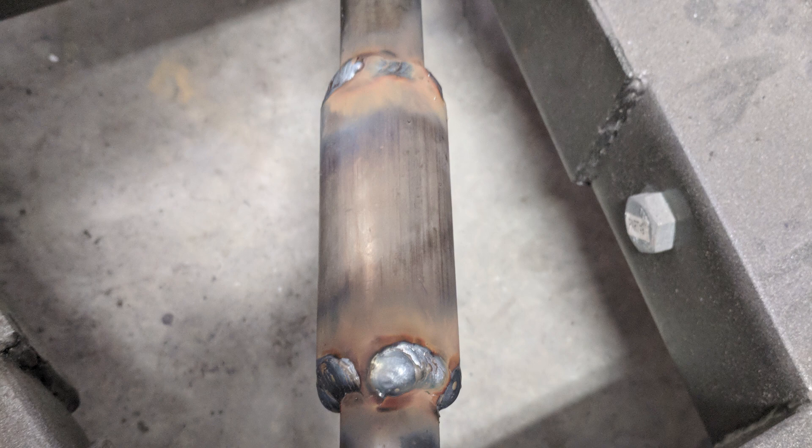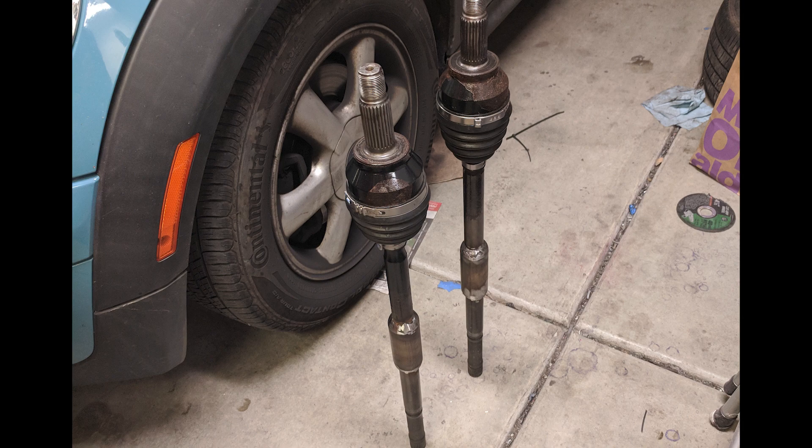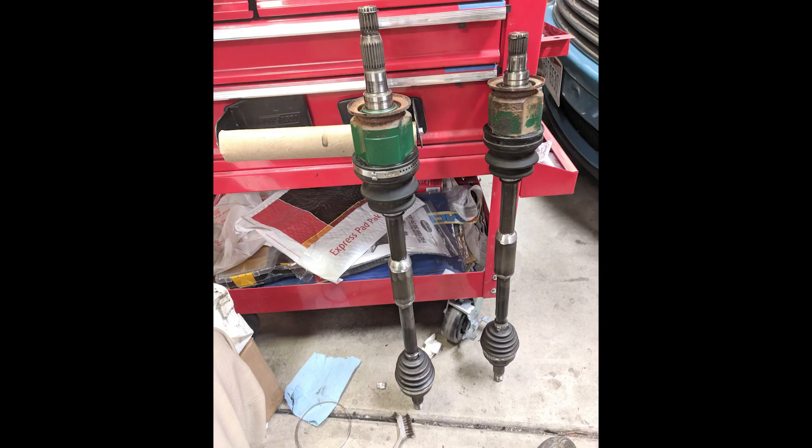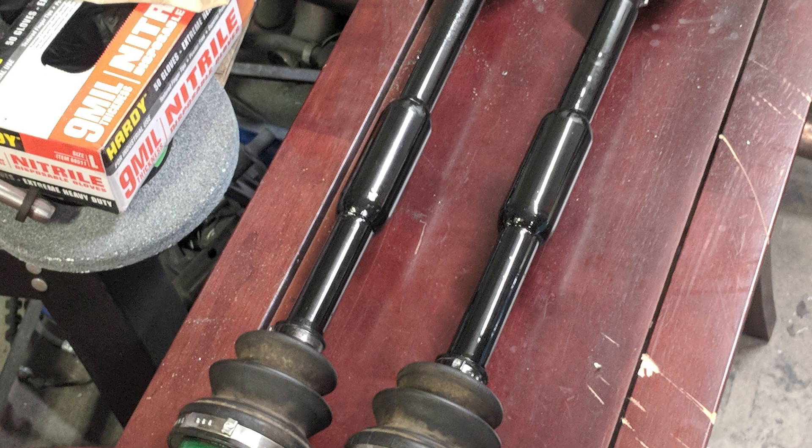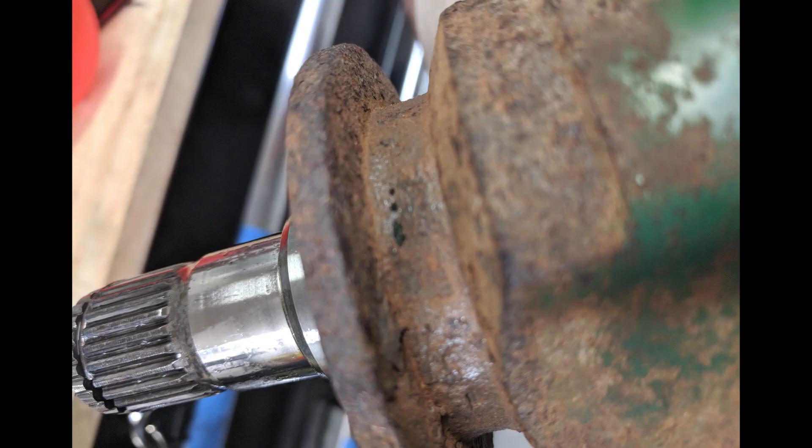We had to mallet it in place, and then we went ahead and did a full two-pass weld on the outside. We did that to both axles and reassembled all the CVs. They balance really well — this is them standing actually up on their own. I haven't gotten any harmonics or vibrations that I can physically feel in the chassis. We went ahead and put a black epoxy paint on it as well, and new CV boots, new joints, new grease inside the boots themselves. We tried taking care of the rust as much as we could; we did have some slight pinholes, but we went ahead and put a rust converter and scraped as much rust off as we could.